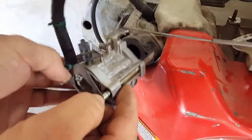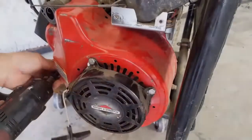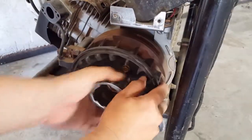In this scenario, the fuel grommet and the filter was already removed from an empty fuel tank. Then remove the three bolts from the cover and carefully remove it from the engine. Turning the flywheel by hand confirms how far off the valve lash really is.